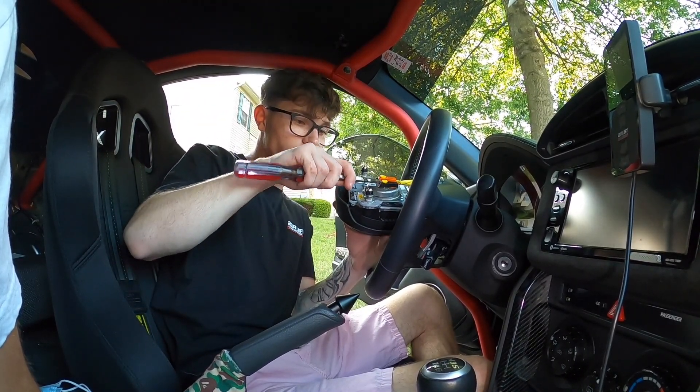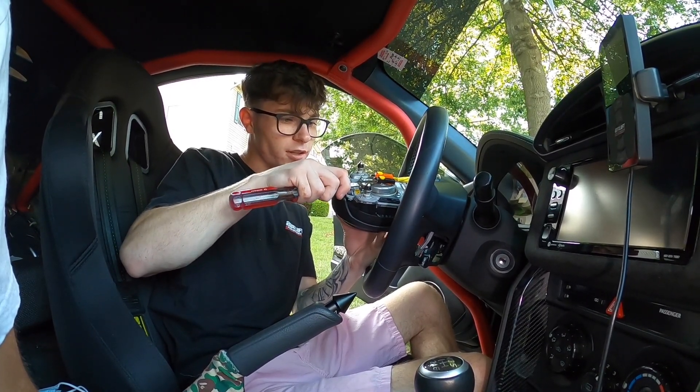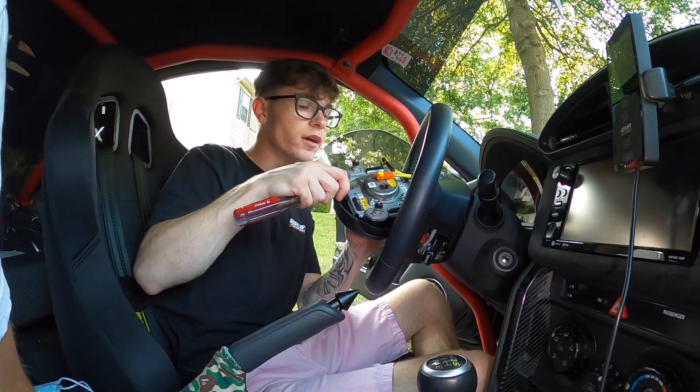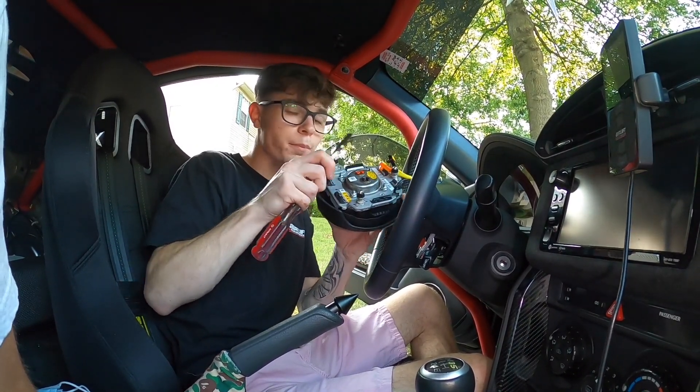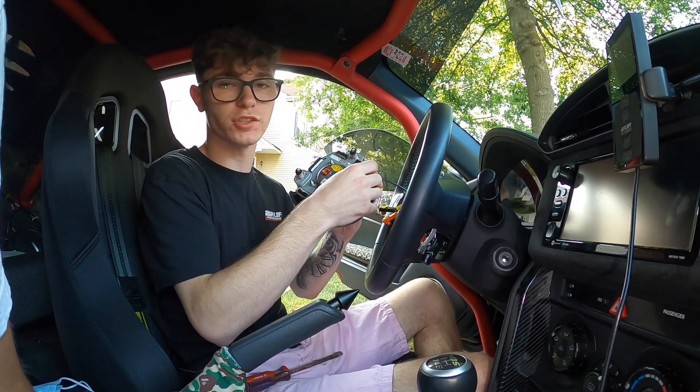This part is actually safe since we have the battery disconnected, so the airbag won't blow. You take your flathead, jam it in there, and pry — I popped a little orange tab up and they just pop right out. I got this one out but I'm not sure about the other one — I think it just pulls out.